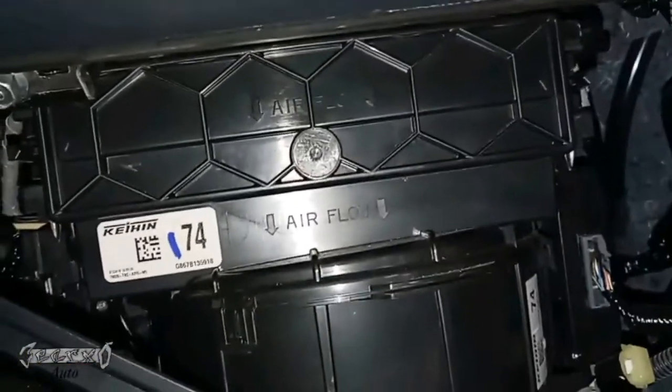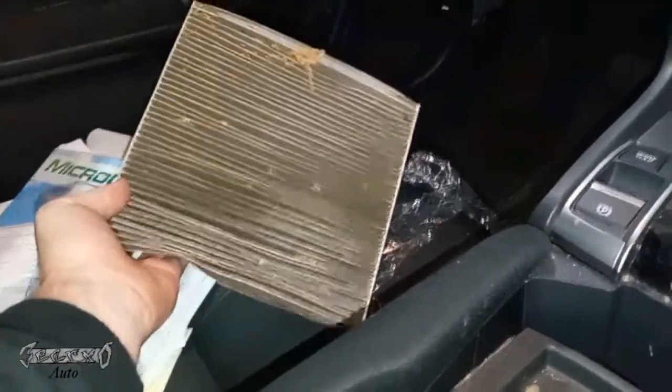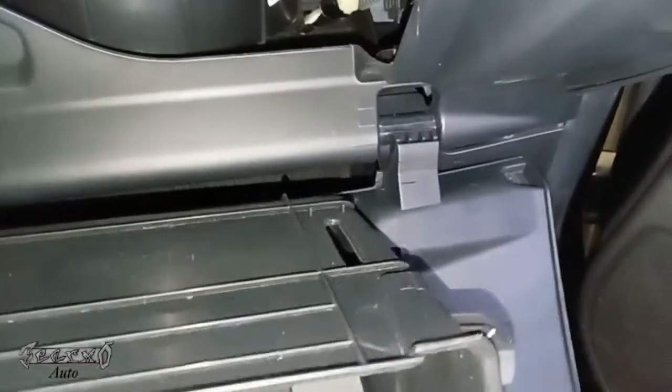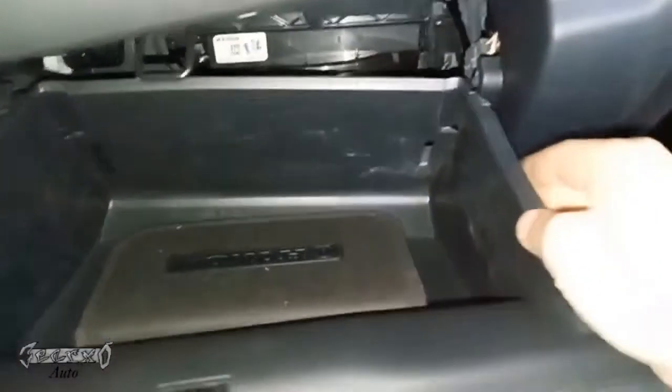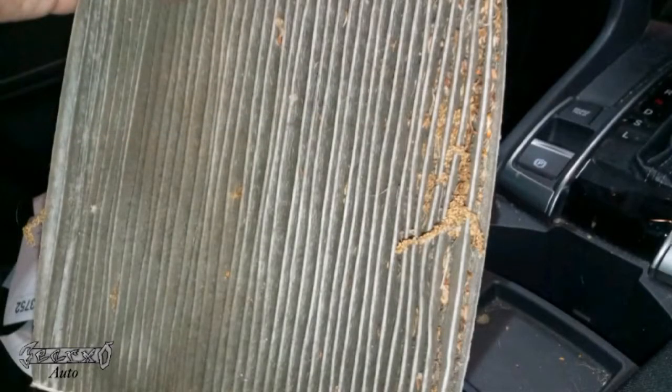Airflow pointing down — and that's how you do your cabin filter. If it's pretty dirty you'll know you needed this. When reattaching the glove box, it can come off the hinges; just line up the hinges first, push until they pop into place, then squeeze the edges inward and push it up. It should open and close fine with no problems. Thanks for watching — hope this video helped. Please like, comment, and subscribe.